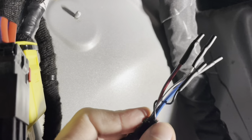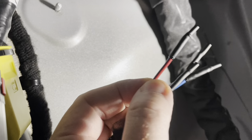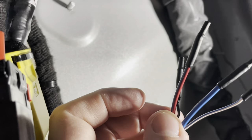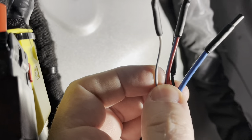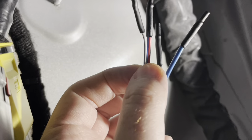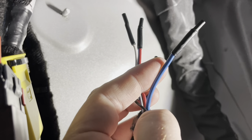Now you can see I have the wires exposed. Looking over the wiring diagram, the red and blue one here is going to be our power feed from the rear fuse block. Then this smaller black one is our ground. The white and blue one is going to be the signal wire from the body control module for the brakes — basically you hit the brake pedal, it sends a signal to the body control module, which then sends it through this wire. And then this blue is going to be our final output going back to the trailer connector for the brakes.